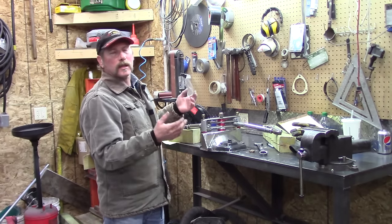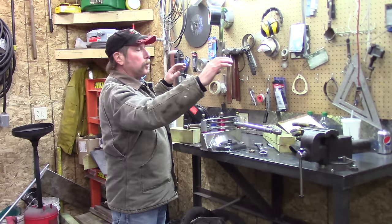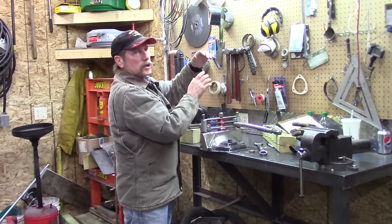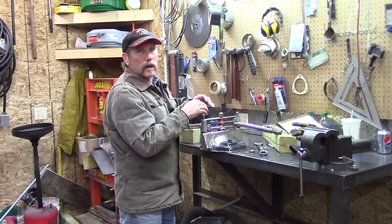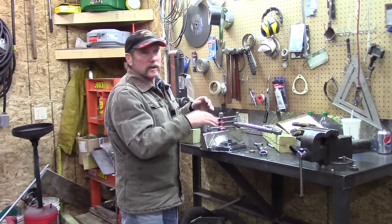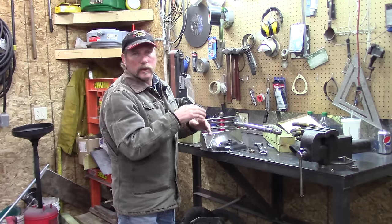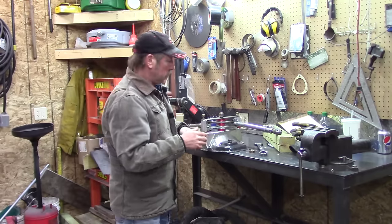Everything's for a Mustang now. If you would have had a brace between the two frames and it was slotted, you can adjust it depending on the ride height of the car. Sometimes the car might need to be higher at a certain track because you've got to bottom out, and sometimes you could go lower and it would hug the road better and handle better, but the track would need to be smoother.